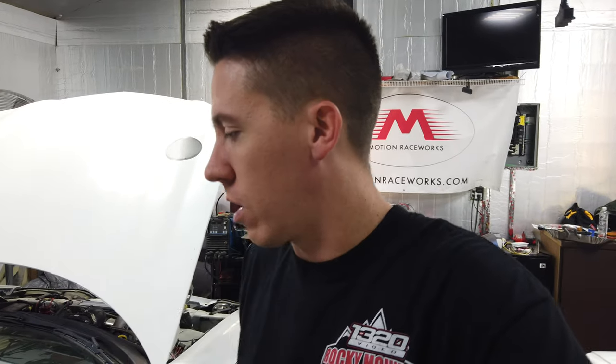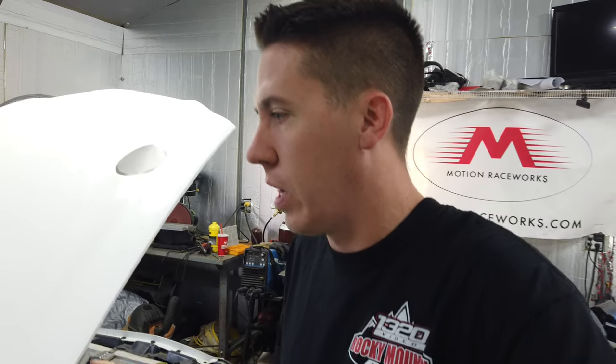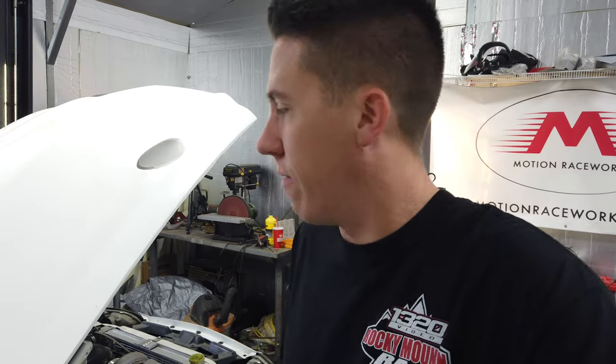So what I do before every year, before I take it out, I always do a fresh oil change. Pull the injectors and clean them. I have my own injector cleaning machine. I do that for some people here and there. Since I melted a piston at one point in time, I just decided to get my own injector cleaning machine and clean them for other people. And I can always clean mine when I feel like it. And then for tuning, if there ever becomes an issue, it's easy enough to throw them in and verify.